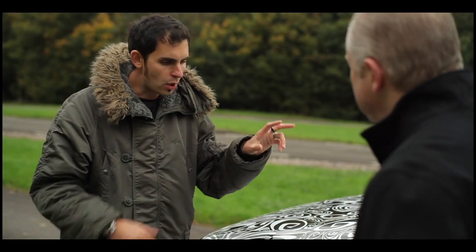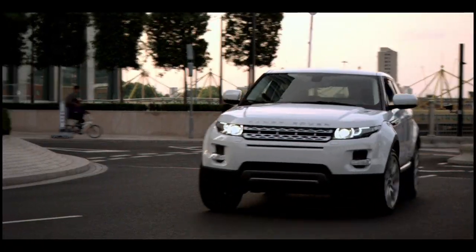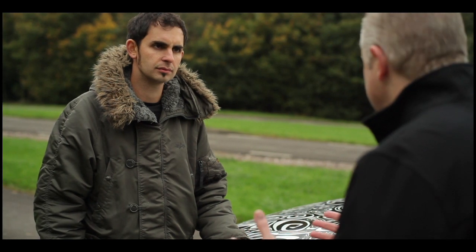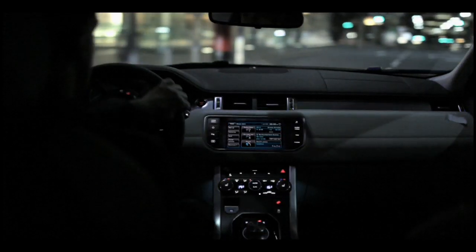Let's talk EPAS — electronic power assisted steering. But why did you go for it in the Evoque? One of the underpinnings of the Evoque is it's got to have an environmental conscience, and traditional hydraulic power steering systems have the pump sitting there spinning, and whether you're using it or not you're still burning two or three MPG. With EPAS you only power it when you need it. Also, because the car's got to be agile, we run about a 14.5 to 1 steering ratio — the quickest in its class — so 14.5 degrees on the steering wheel gets you one degree at the wheel, but obviously that could make it nervous at speed. What EPAS allows you to do more than any hydraulic system is change the damping, the inertia feel, and the steering effort when you press a button, which is really hard to do with any hydraulic system.